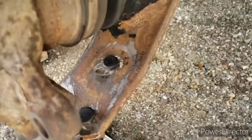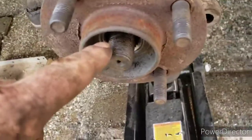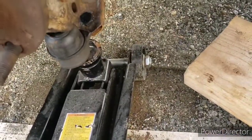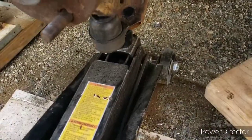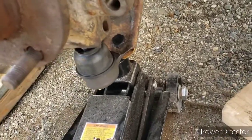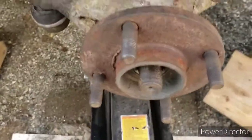When you get your bolt — I couldn't find any specs for it, so I just tightened it down pretty tight. When you put this bolt on, it's 180 foot-pounds. The pinch bolt is 50. So I'm just going to gently jack up the lower control arm so that ball joint will pop into place, and then I'll put the pinch bolt on. That's pretty much it, guys. Put the tire back on, torque everything up.